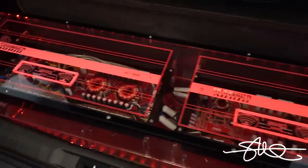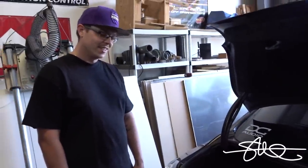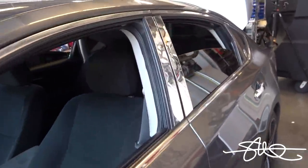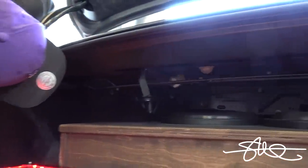So clean. I mean, you rode around, the gains weren't set. Now the gains and the crossovers are set pretty close. You're as good as you can be for what you have for a head unit, little upgrades. But I want to run some more second skin on your rear deck lid. I know we got to take those old 6x9s out, but that means we got to pull your deck lid apart to get to them. So those 6x9s or whatever those are in there got to come out, and we're going to run a bunch of second skin on the rear deck lid as well.